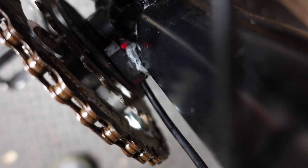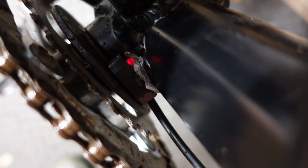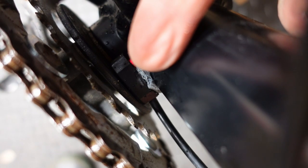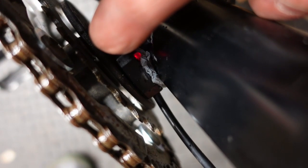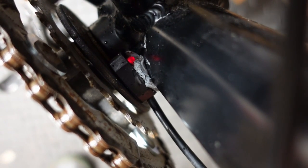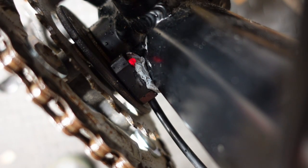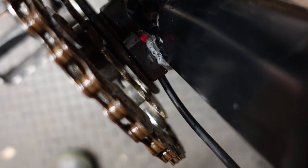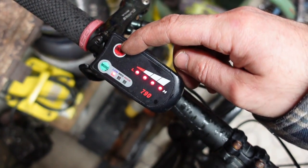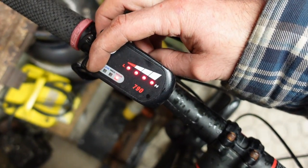So if I turn it on, the light should come on here. There you go — there's a little red light in the centre of the screen. This little guy here in front of my finger, a little black thing, it's the sensor, and over here there's a ring attached to the crank — just pushes on. You've got to remove the chain wheel but the crank ring just pushes on. It's a ring of magnets mounted in plastic that runs past the sensor, and you can see that little bit of Blu-Tac in there. Up on the dash control it's got on/off, which you just press and hold, and it's got mode: low, medium and high.